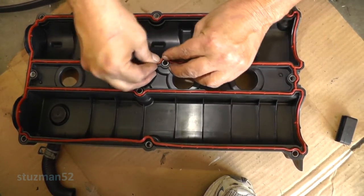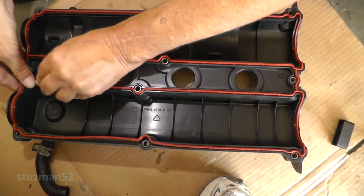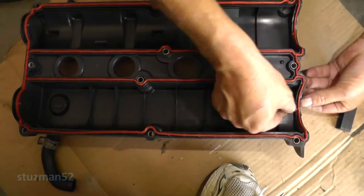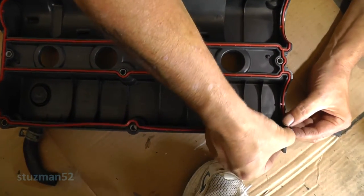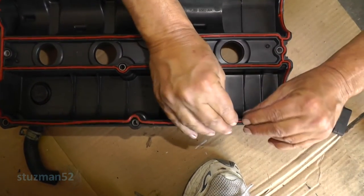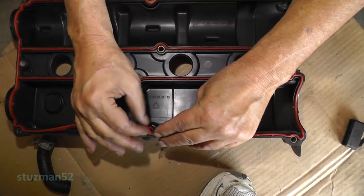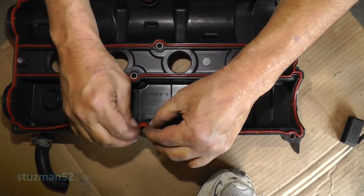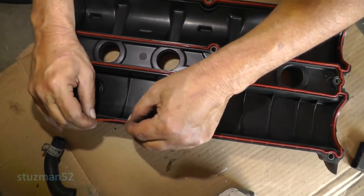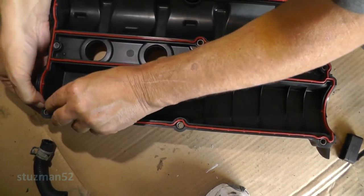You want to make sure your valve cover is all cleaned and you got these grooves cleaned out, which I've already taken care of. Let's push him all the way until he hits the bottom. We don't need any dog hairs in there. And that turns out to be just a perfect fit - the engineers did a pretty good job with this gasket.